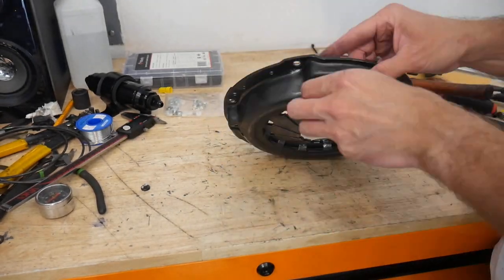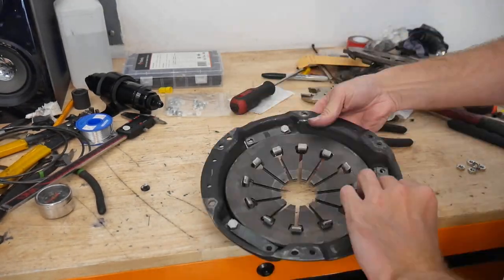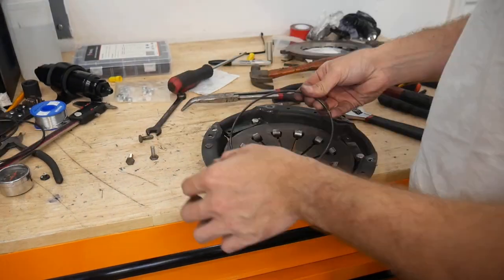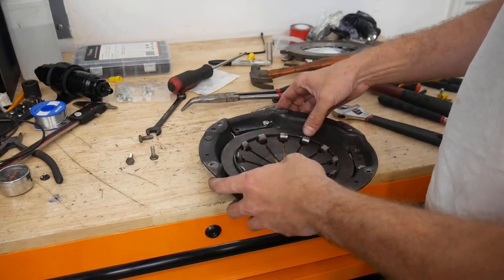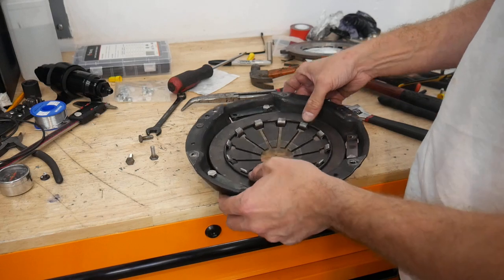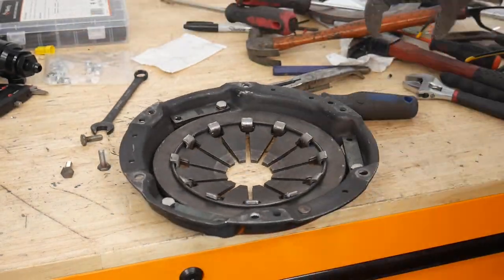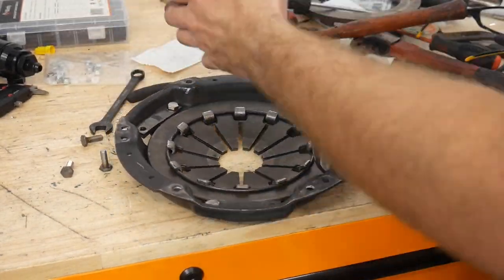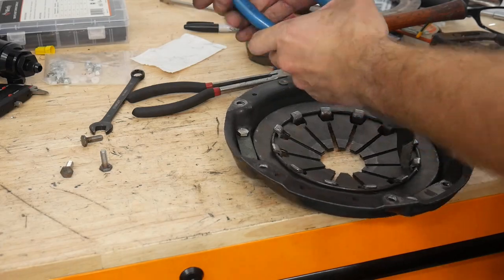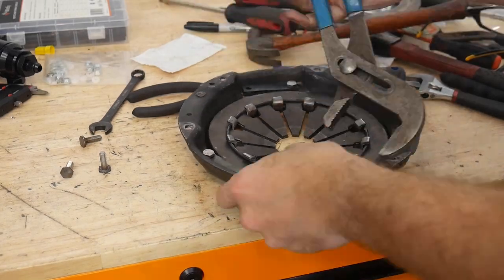The order I'm doing this: the straps go in on the basket side first, using the shorter half-inch bolts. It's very important that you use stainless steel for this task. Once you've got those tabs nice and snugged, we're going to put our spring retention ring back in and bend these tabs on the sides to hold that ring into place. It is possible for these springs to get out of alignment with one side a little further over than the other, so make sure this is centered as much as possible because this entire basket is going to be rotating with our entire rotating assembly — you don't want serious vibration coming out of your engine.